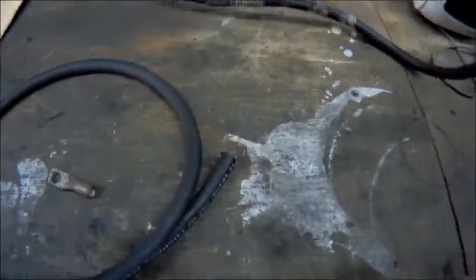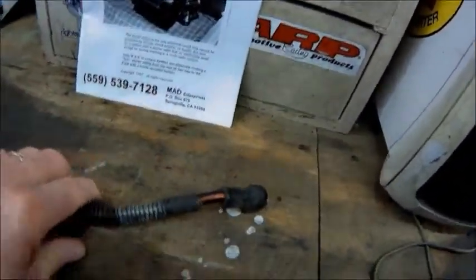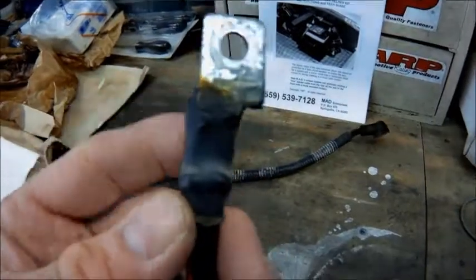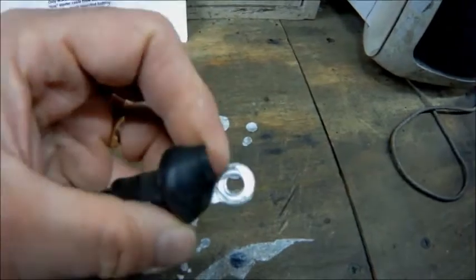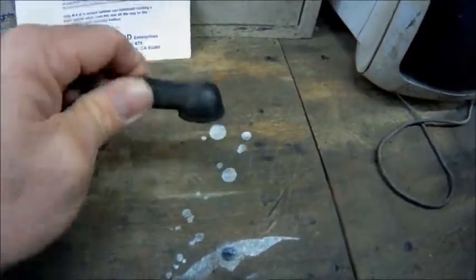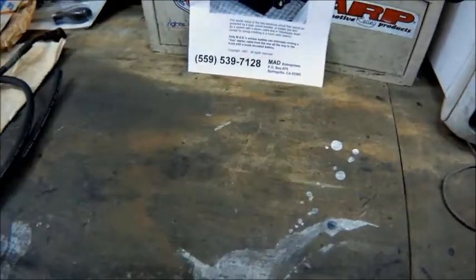Another thing I found out is — I'm kind of a junkyard scavenger. If you go to the junkyard, a lot of the factory stuff — because the electrical systems on cars are so sophisticated now — they have really nice cables you can use on your car. This is like an alternator wire cable setup off of like a Ford Taurus or something, but it's all high quality stuff and it works really good. It looks factory — it's got a nice protective boot. This is the cable that would bolt on to the back of the alternator to that BATT fitting, and the boot slips over to protect it so you don't get any arcing from metal on metal. I got this from the junkyard for like five bucks, so don't necessarily rush out and order a bunch of stuff from Summit.